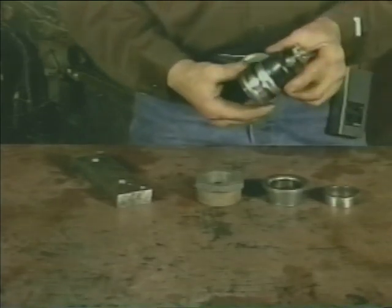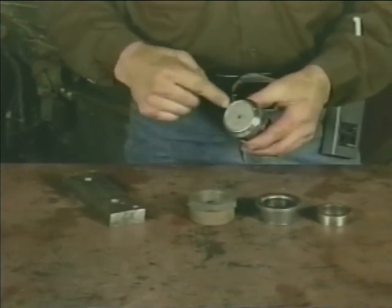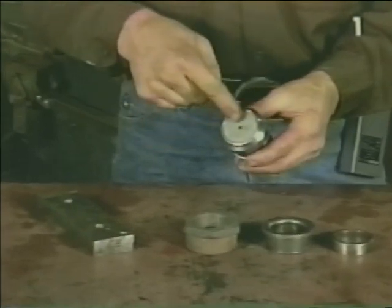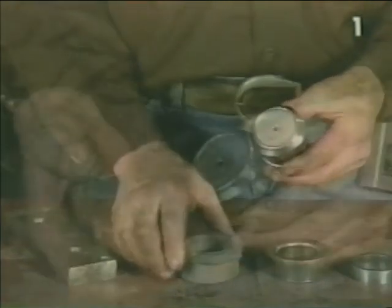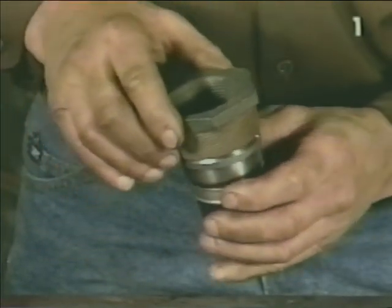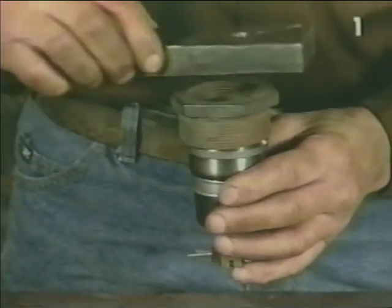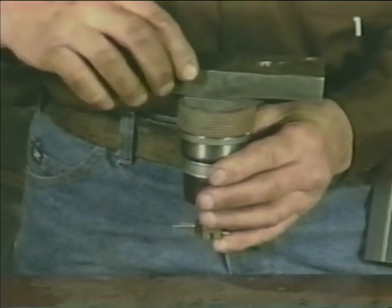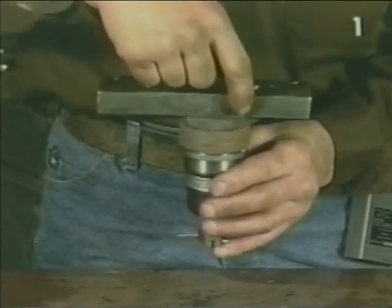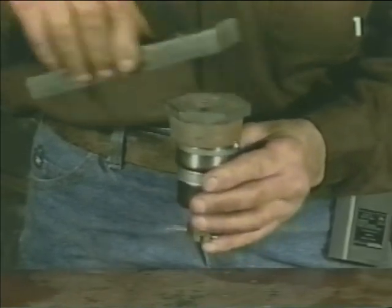To install the lower ball joint in this application, the ball joints are pressed into the control arm. To do that, we need a tool that will locate itself around this area of the ball joint without contacting the soft center. This pipe bushing lends itself readily to this application. We need this block of steel for all our bushing driving to span across our installation tool so that when we strike it in the center with a hammer, it spreads the applying force evenly around the component.